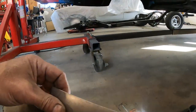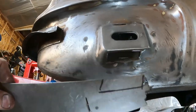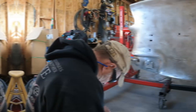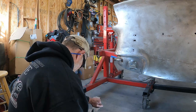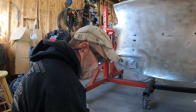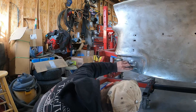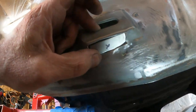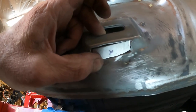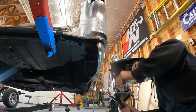I found a trusty piece of scrap sheet metal, drew my approximate size of the patch on there. We'll buzz that out and then start fitting her for real. A little more trimming and I think I'm going to call that close enough — it's not perfect, but we didn't expect it to be, right? Let's get the welder set up.